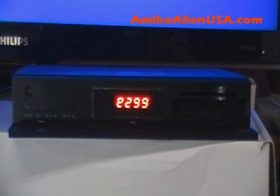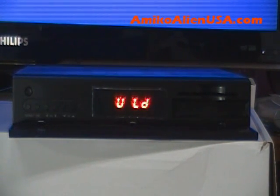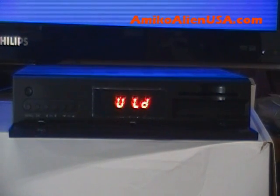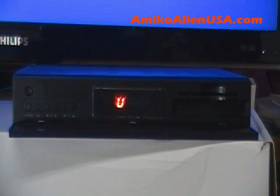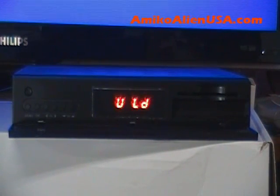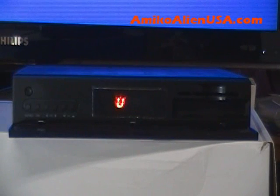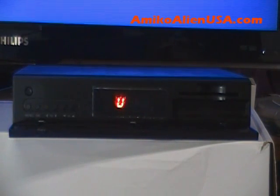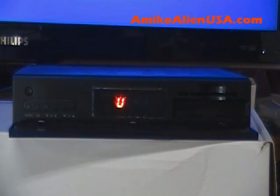The load will start — it's going to give you a whole bunch of numbers and messages. It will reboot itself when it's ready and eventually load your Enigma 2 image. This takes a while, so go get a drink or do something else. Don't turn it off while it's loading. You'll know it's done when your TV displays the welcome screen for setting your language, resolution, and all that.